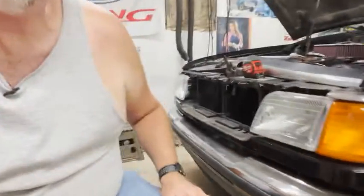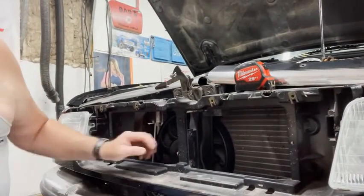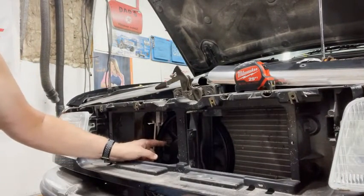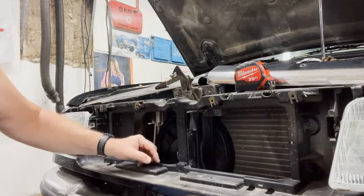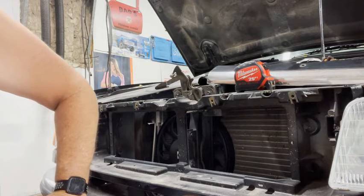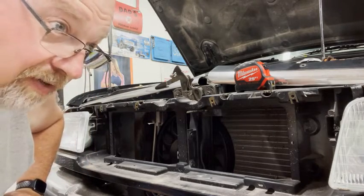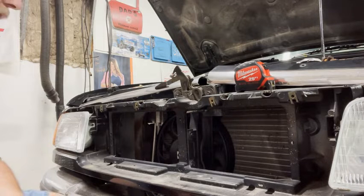Now you get a better look at what I did before. Down in here is the fan I'm using — they call it a swirl blade — and it just isn't moving the kind of air I think we need, so I'm looking at other options. Right now Permacool has the highest claimed cubic feet per minute rating. I question that — when I called and asked them if it was accurate, they really didn't answer me.